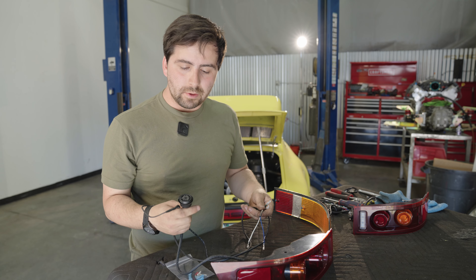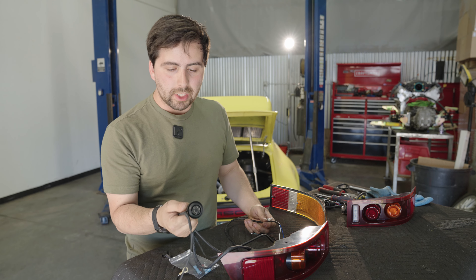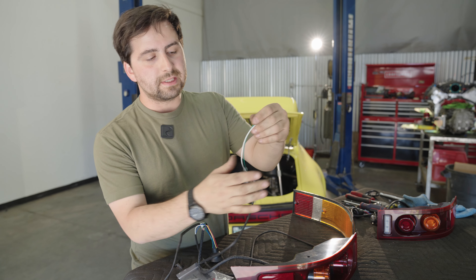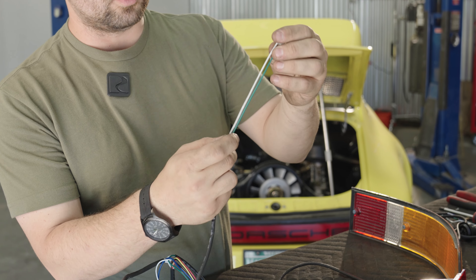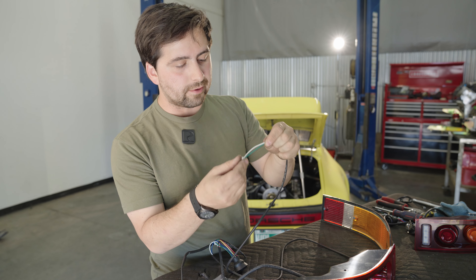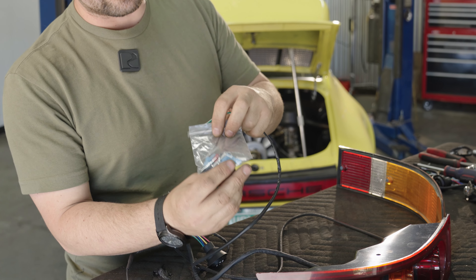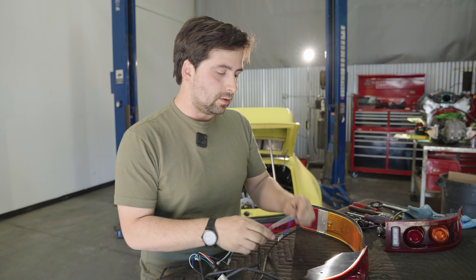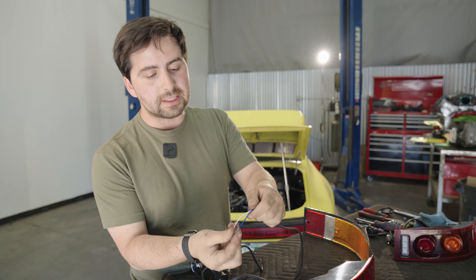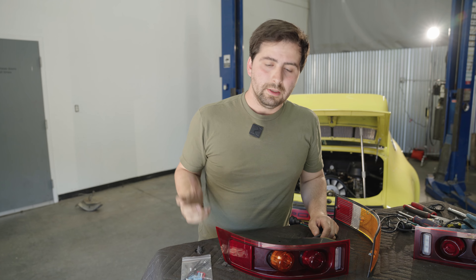Back on the bench I'm just going to do an overview on the wiring for this taillight. We have the main body harness just like the one we unplugged. We have a single spade connector that's our ground. On this side we have a green and white wire — this is for your rear fog light if your car came equipped. Inside the supplied hardware bag we're going to have different spade connectors depending on your application. There are two smaller spade connectors, one blue and one white. This is for the license plate light — the white being the ground and the blue being the power.